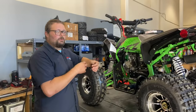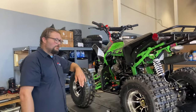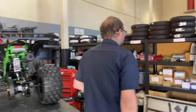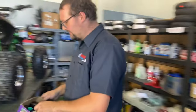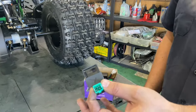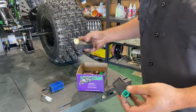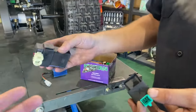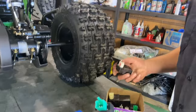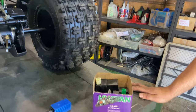I've experienced this on my own scooter — it started bogging down, I changed the CDI box, and it fixed it. The CDI is an electrical box that controls the electrical current. They come in different connector styles — some have a little green connector, some swap to white, or another style. It's a black box, and depending on your ATV, the manufacturer uses different types of CDI. It controls your electrical system that's generated by your stator, which functions like the alternator.